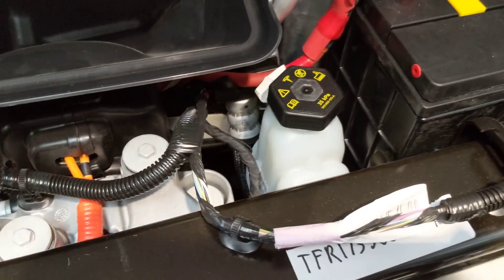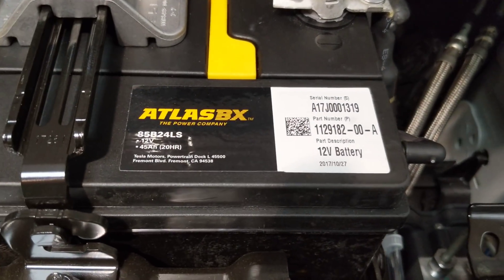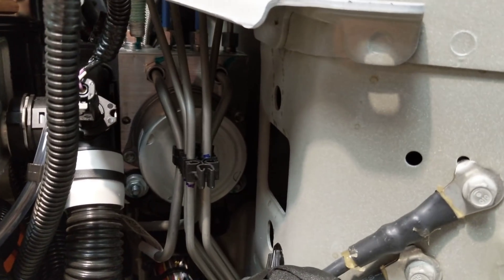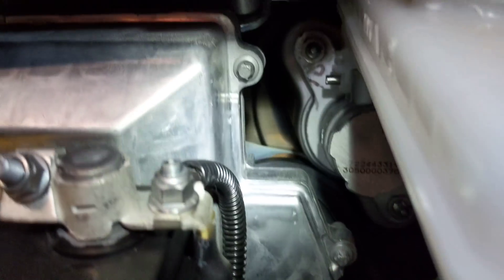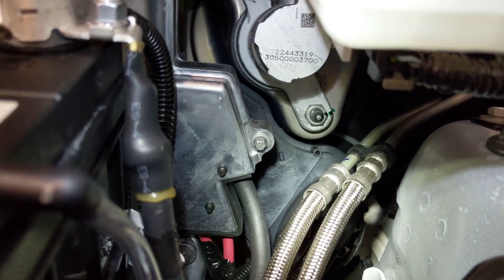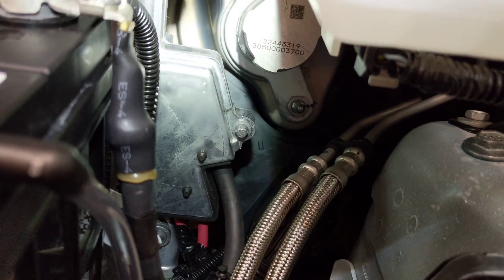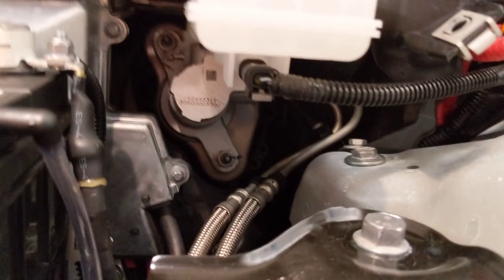There's the glycol fill. We've got a little 12-volt battery rated at 45 amp hours. The ABS block is there — it looks very similar to ESP2 on the Model S. But we don't have an iBooster. There is an assembly here with what appears to be a big electric motor off to the side with a Bosch logo on it, so it's probably some sort of electromechanical brake booster, similar to iBoost but with a conventional master cylinder with two lines hooked to it.